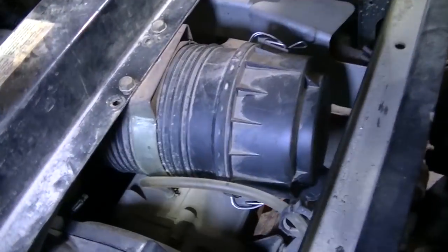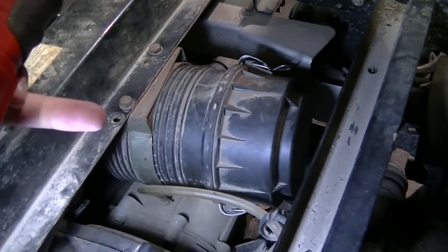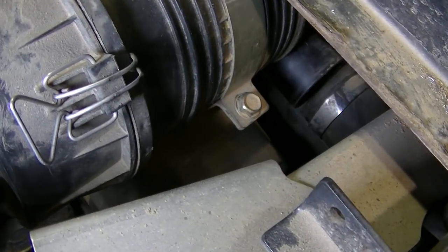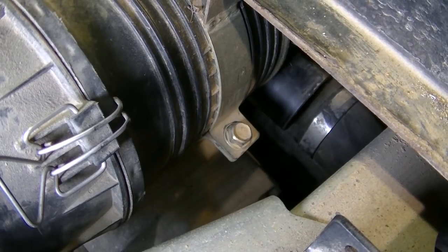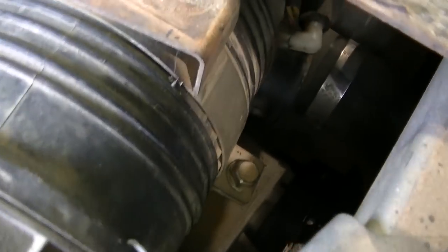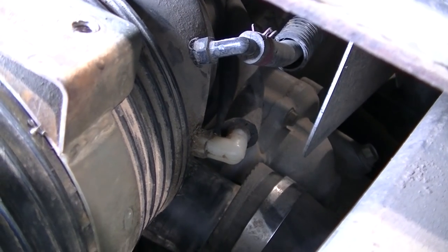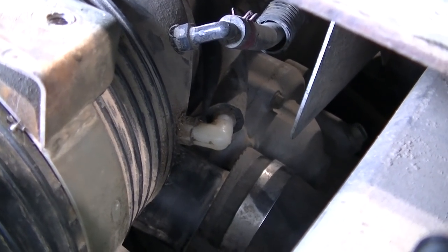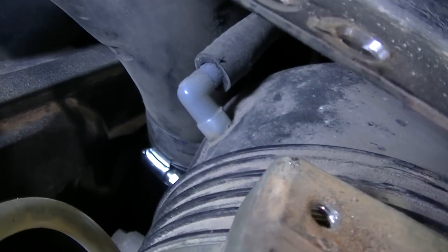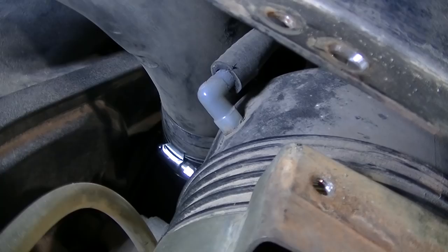There's the airbox that's gotta come off — two bolts right here and right there. I'm gonna pull it out; should be an easy swap. Then you gotta unhook your air intake tubes that go to the front. To get this air filter out, you're gonna have a bunch of tubes coming off of it. Mine's actually got three, and they're a bear to get off — they're stuck on there pretty good. I'm gonna get them off and pull this air cleaner out.